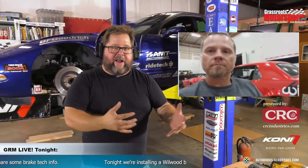Let's start off in very, very broad terms, just talking about brakes and why we might want to upgrade them. At a very basic level, we're taking the kinetic energy of a 3,000-pound object and turning it into heat, and we're doing that through friction. We could turn that energy into any other kind of energy we want to, because we want to get rid of that kinetic energy. Heat is a very efficient thing to turn into. We could turn it into light. We could turn it into sound. Whenever you hit your brake pedal, your car goes ah! But that's going to take a while to slow down.